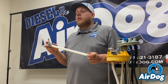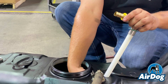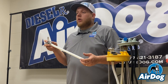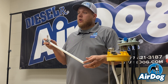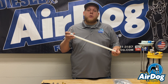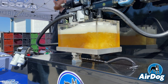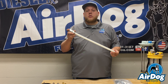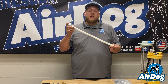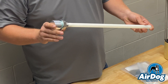If you have a 150 gallon per hour fuel system, you will need this upgraded draw straw — a 5/8 inch draw straw. Since we are returning so much fuel, we have to overcome that loss by pulling more to the AirDog itself. We use this larger draw straw to reduce cavitation on the pump and prolong its life. Failure to install the draw straw on your FP150 or required applications can cause premature wear and failure of the AirDog.